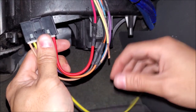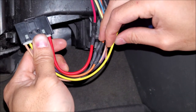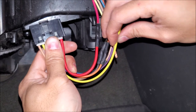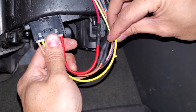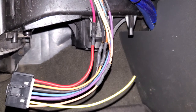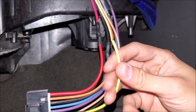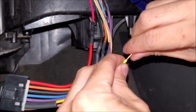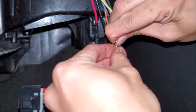When you have your factory wire positioned like this, check the length where it needs to be. I give myself room for error, so I cut it back a little further — almost an inch. Then this wire needs to be there roughly — go ahead and cut it. Make sure you have your shrink tube on there beforehand. The shrink tube that comes in the kit is nice because it also has glue in it. Strip it back, twist it, make sure we twist really tight.